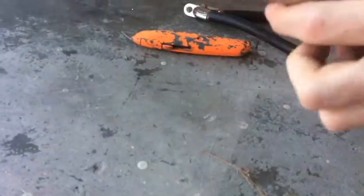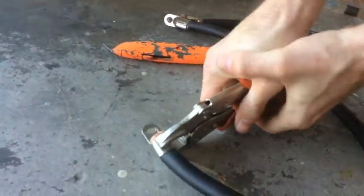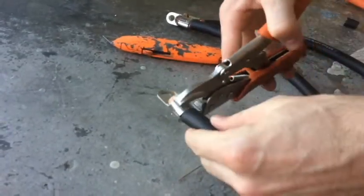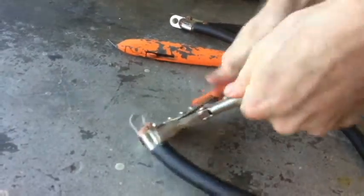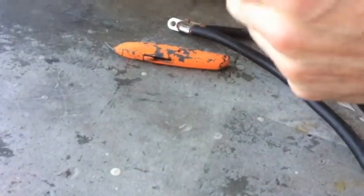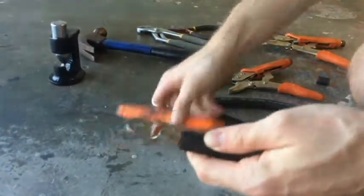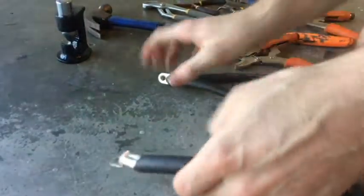I have different size channel locks because sometimes if you're using certain channel locks, it will only tighten so much. So all I'm doing is just making sure my adjustments are right on my channel locks, and I'm tightening in place and squeezing into the middle of the terminal, and that's causing it to not go into the middle. So that's really one of the options you can do for ring terminals. That's the way I started off doing it. That is one option. Now here's another option.